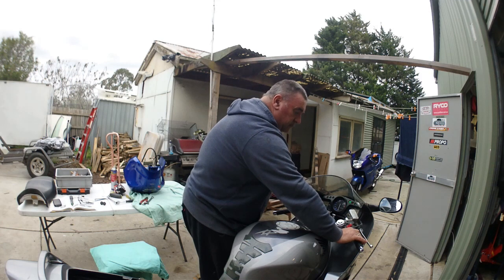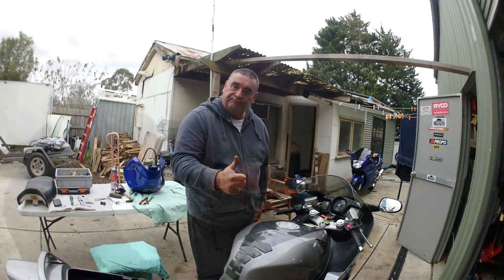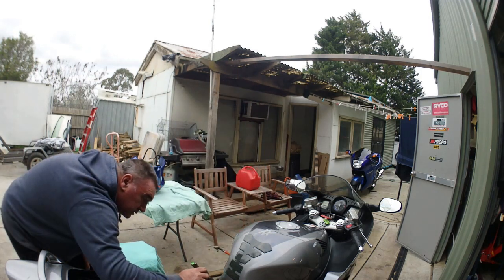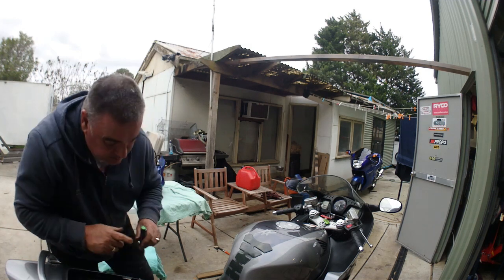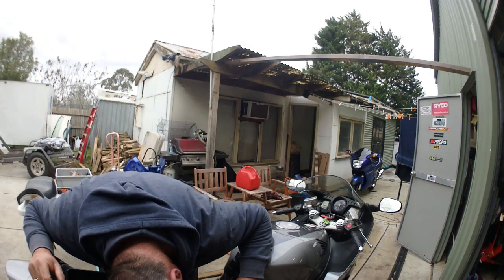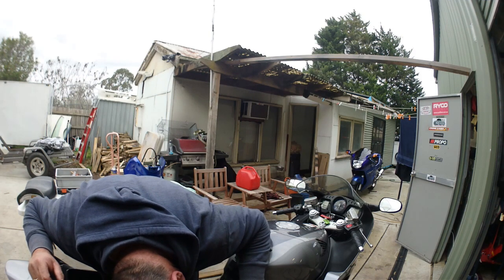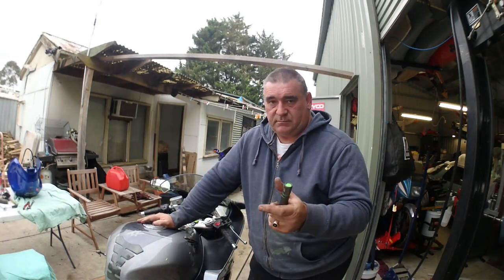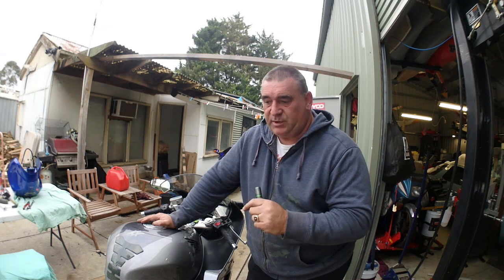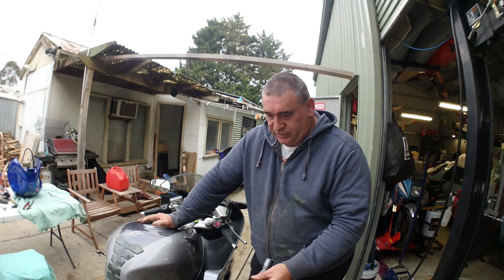Pump up. Let's go down and have a look in there. Nothing dribbling there. Nothing dripping there. This bike's run at about 64 psi, so if there was even a chance, like a small leak, it would emphasise it just with the amount of pressure that's pushing on it. So that all looks good.